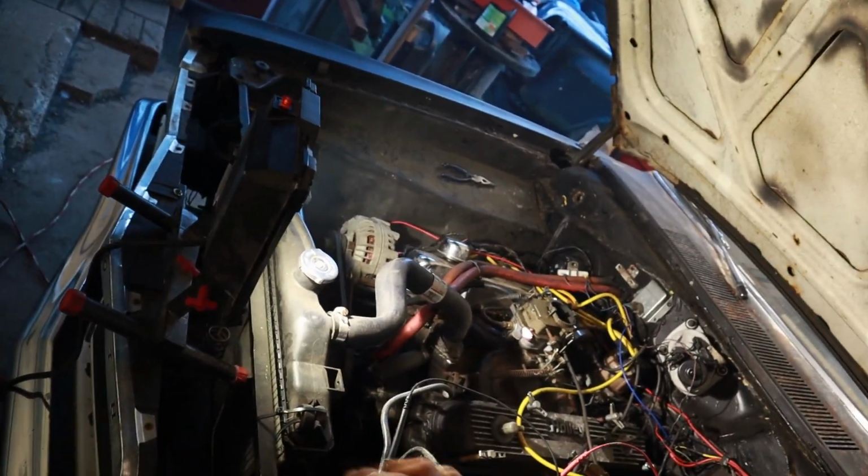This speed connector had been loosened up to fit a wire to run to the battery. I didn't realize cranking it was making it fall off every time, so that's why it would start only sometimes. I'm just rambling, but it runs off the key now. I can go through and loom all this stuff up. The big thing is what I want to find out... Matt, I'm trying to pull the battery cables off.